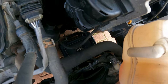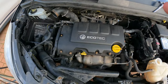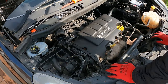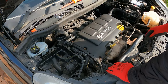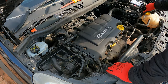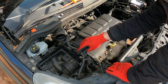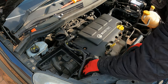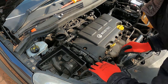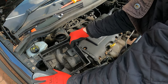All right, let that empty out. While that's doing that I'll get set up on the tripod and then we'll start taking some of the other stuff off. Coolant's pretty much drained out. I'm going to leave the cap just loose on there and tighten up that drain at the bottom in a little bit. So I think we'll start on this side and get everything disconnected — just a case of unclipping all the sensors and wires. We've already taken off the top of the airbox because we did that in the last episode.